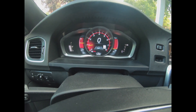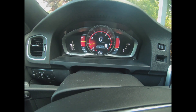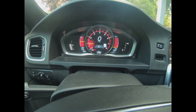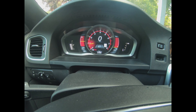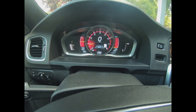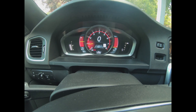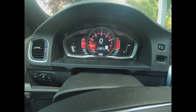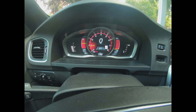One of the things Hilton also did was adjust the idle RPM, which is now at about 800 compared to the stock one which I believe was around 580. He adjusted that just to get the engine to run a lot smoother compared to the OEM idle, which was a little rough.